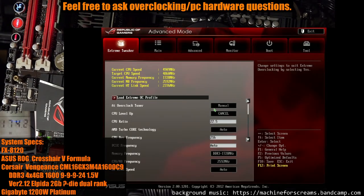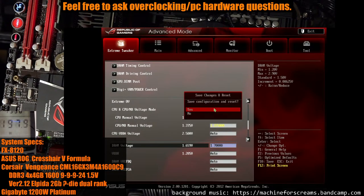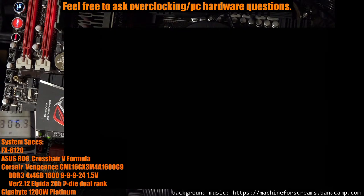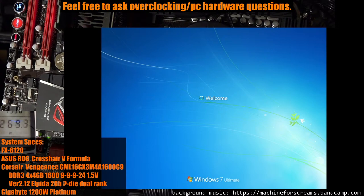We're going to go slowly on the voltage because there's a few DDR3 memory chips where if you just smash them with voltage, they get worse, and sometimes it happens quite early. I think there's some Samsung 2 gigabit thing that I had in my collection. I don't think I still have it. But if you went over 1.72, I want to say, it would just immediately clock worse. It definitely didn't scale to 1.8. And there's a bunch of other DDR3 chips that scale to 2.2 volts or something, where you are concerned for the health of the memory controller, because the memory controller will actually die before the memory chips do.